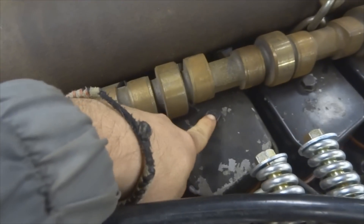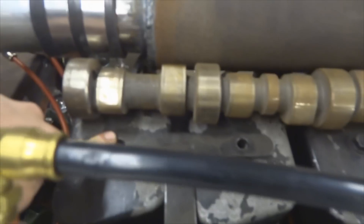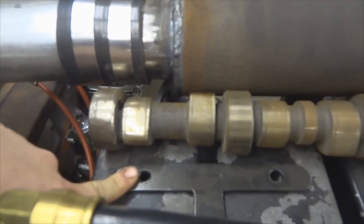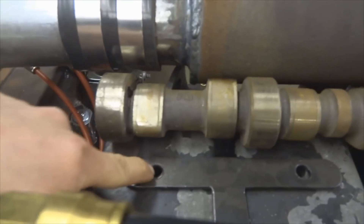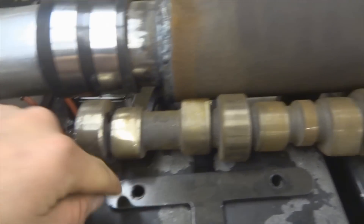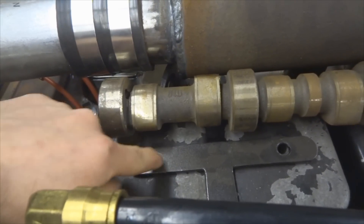I also have to figure out a power steering pump. It's been kind of slow progress and I'm waiting on some studs from the machine shop. You can see right here there's just a regular bolt that holds in these valve covers. I wanted to stud this so I can tighten down the valve cover and then tighten down this bracket to that stud, so I'll have pressure going down on the valve cover and then another nut holding this bracket in.